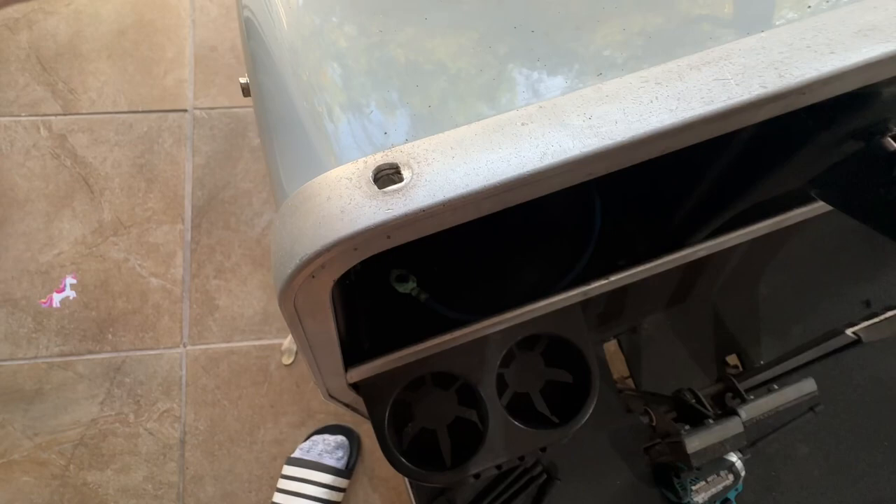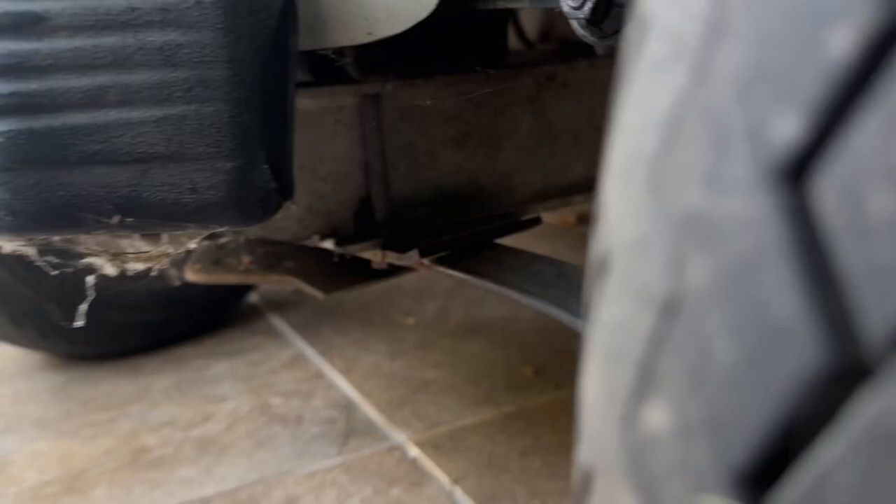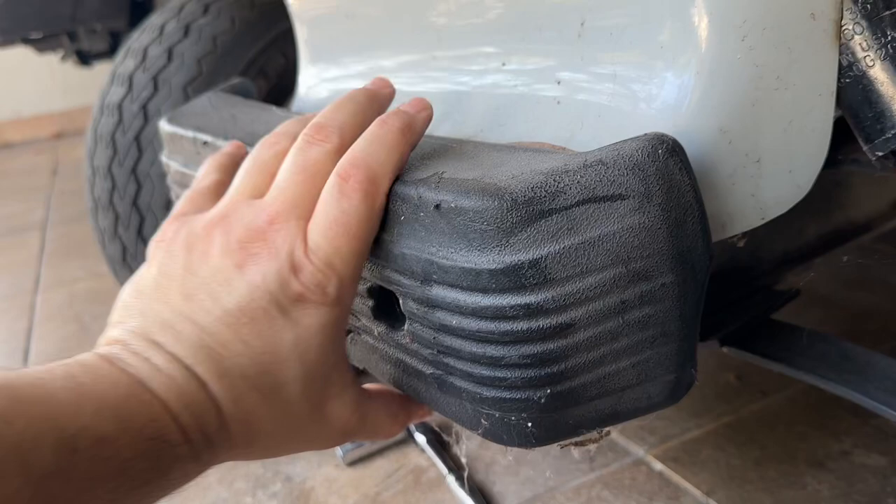Once that's off, it frees up that metal plate pretty good. Next you're going to want to take these two screws out of the bumper — this thing has a nut way under here, hard to see. The size on this is going to be 13 millimeter, and it's getting it off there. These must have been replaced because I'm sure the original ones were standard. Phillips head here on the front side — get the screw out and you've got two bolts here to get out of there. Note that the screw is loose and should just pull out. That frees up this little lip of the body.